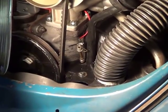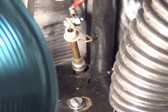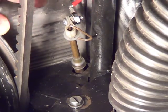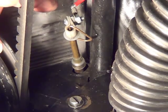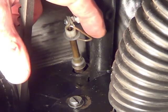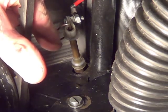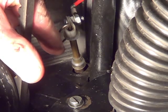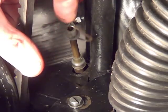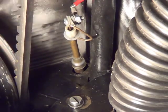Let me get you a little bit closer. Things are close right there. You've got your wire going behind the generator stand and over to the side. You don't want that screw to touch any metal, because if it does it's going to complete the circuit and cause your light to come on. This is just dangling out here, and as you start the engine it comes around. At normal temperature it runs about at a 90-degree angle to the screw. If it gets too hot it'll come up and start tapping the screw, and the light will flicker.